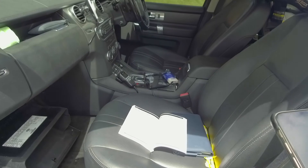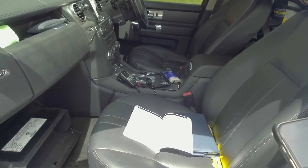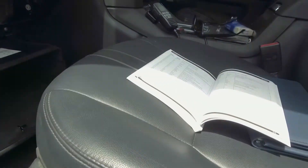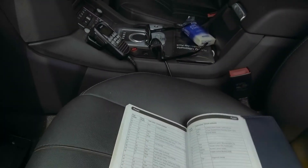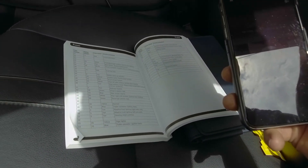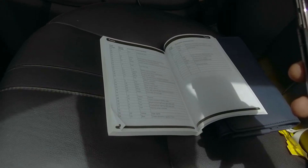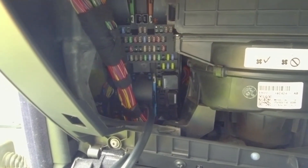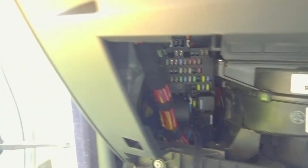Good day everyone. Today is the day we get to work on the Land Rover again. The job today is to do the ignition signal wire. The first thing we did was jump into the passenger footwell, locate the fuse box, and get out the vehicle manual. We subsequently found out that fuse number 54 is the trailer connector, and that is also an ignition feed. So we're going to use the parts that arrived in the mail and jump off fuse 54, running a cable all the way to the back.